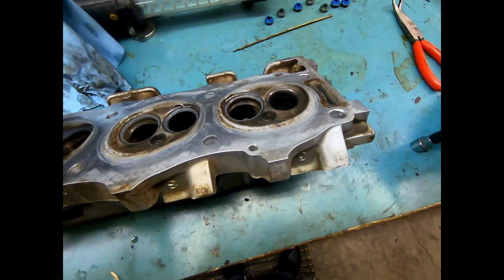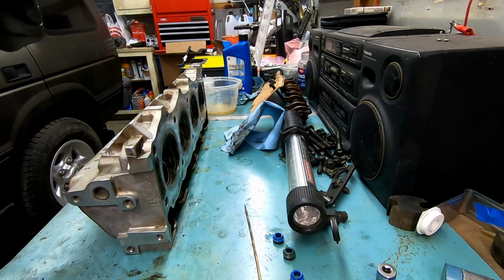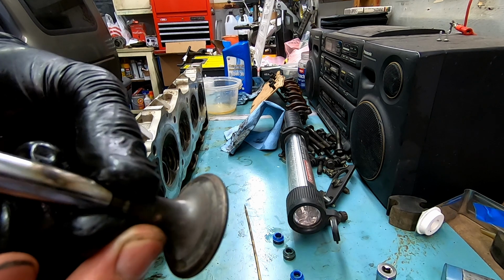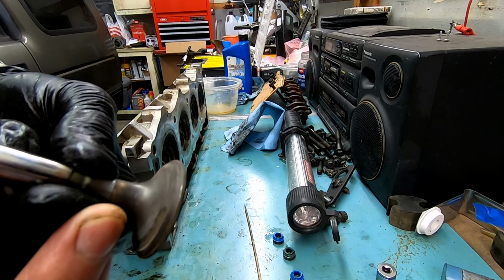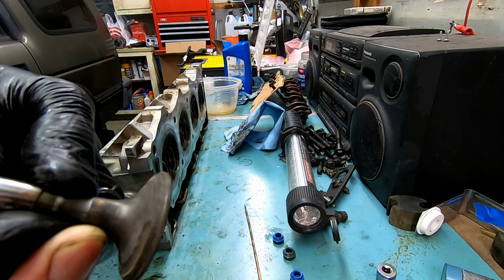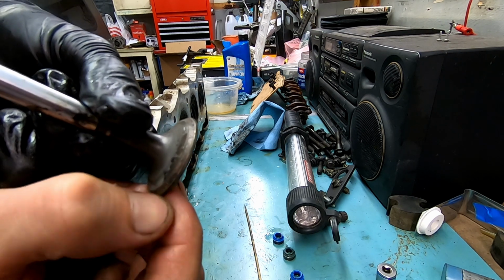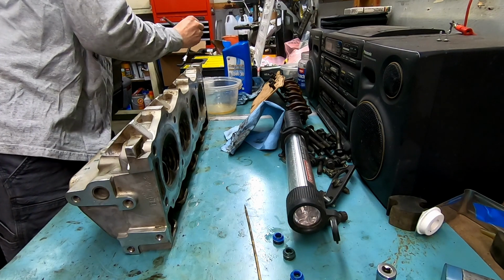Do the same thing one more time for the exhaust. So I do maybe 20% more time and pressure on the exhaust. Here's a really good example here. I'm not sure how well that shows up, but you can barely see any shininess. Exhaust valves are obviously hotter, smaller, hotter. They just tend to get burnt. They get a lot more stuff caked on. So there's practically no shiny, smooth edge. So we're going to remedy that with just a little more pressure, a little more time.